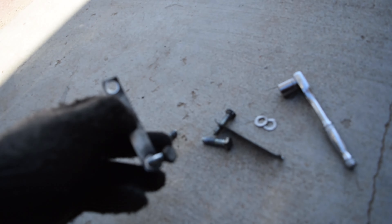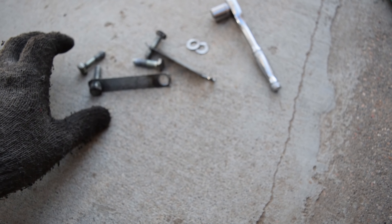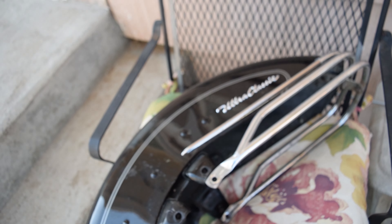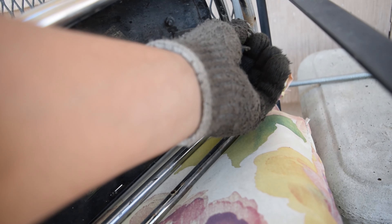The wheel has these little locking tabs that flare out and lock the bolt heads in. I'm going to use Loctite on reinstall and skip those locker tabs. To get the tabs off I used a sharpened flathead screwdriver. With the fender off, our rail only has one hole so we'll enlarge that one, and these other two are going to get enlarged quite a bit. On the inside I'm going to shave all these bolts down and possibly eliminate the bottom one entirely.